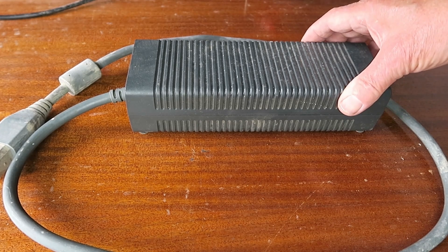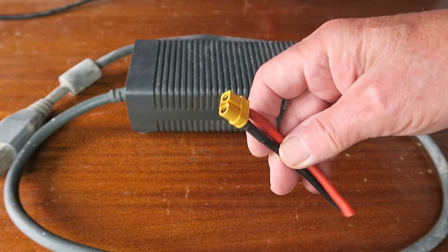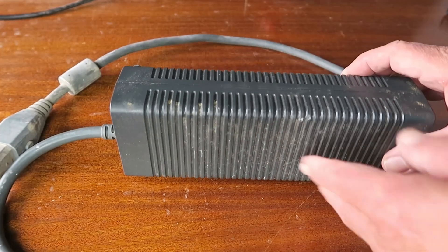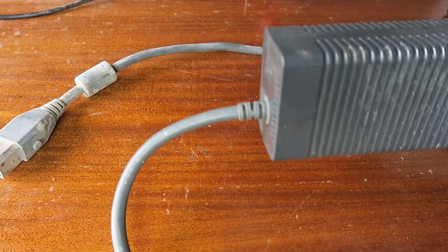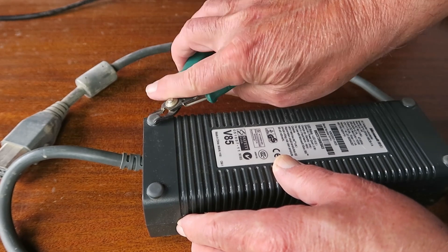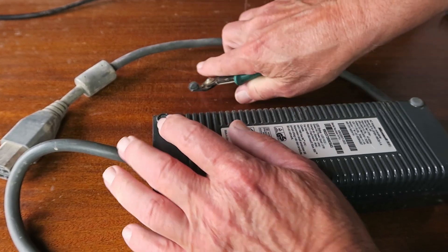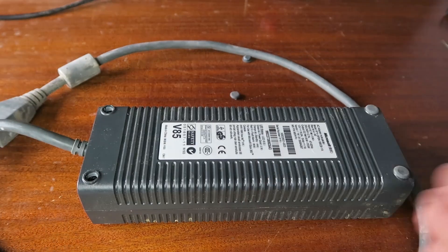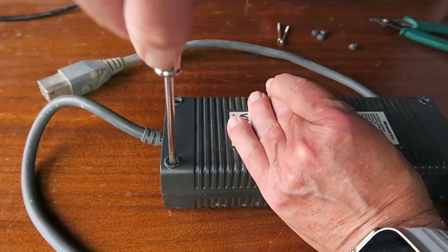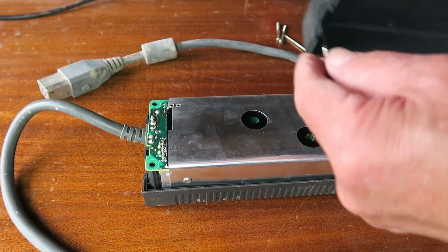In this video I'm going to show you how to modify this Xbox power supply to supply power for any charger of your choice. I'll be using an old XT60 connector from a deceased battery as the output connector. First thing to do is get inside — we want to remove the rather unwieldy cable. Using an old blunt pair of side cutters we can remove the rubber feet, and after a degree of persuasion they do come out. Underneath those little plugs are regular crosshead screws, which are rather tight.